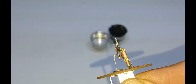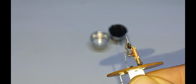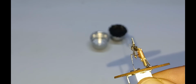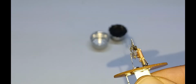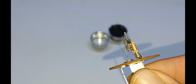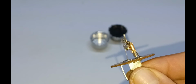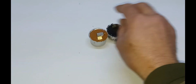Those are made out of copper, I'm pretty sure, looks like. So when that closes and it only makes like 10-15% contact surface area, it is going to start to pit, and pretty soon it will not be making continuity across it at all. Now, for us guys who use our turn signals, unlike the people here in Colorado, that would not last very long, maybe 10, 20,000 miles until you had to take it out and throw it away. So that's our Chinese unit.